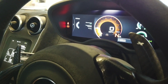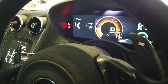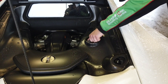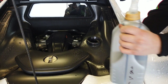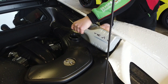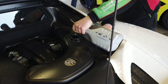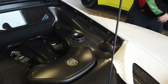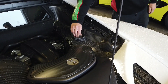Low oil can cause fairly significant damage to the engines of these cars — it's something to be very wary of. We check every car that comes in and throughout the day we carry on checking it. If you do need oil, you top it up. On the 675LT, just pop it up and there's an oil cap there. We only put small amounts in each time — no more than about 100 to 250 millilitres, a quarter of a litre at a time, then check again. It's very easy to overfill these cars. We use Mobil 1 Motorsport oil, the same specification that McLaren use. Once done, put the cap back on, make sure it's tight, and drop the lid back down.